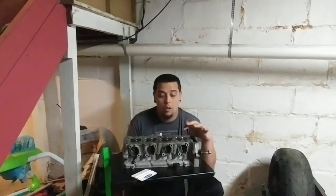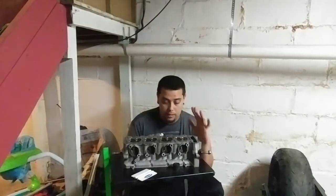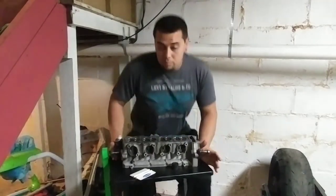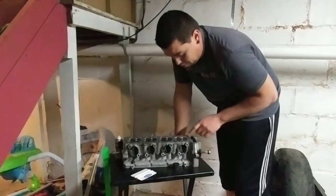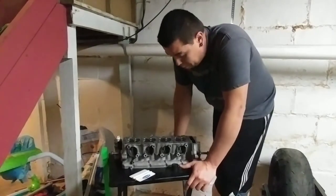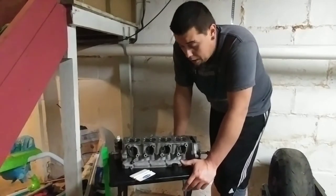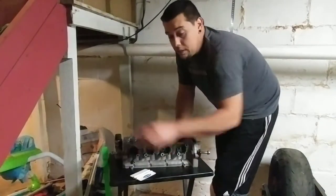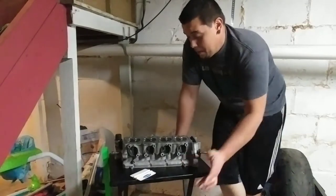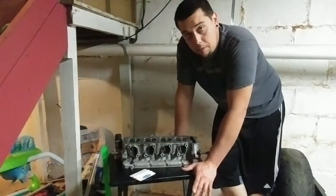I'm going to let this sit overnight, and when I get back to it, I'll let you guys see how good the stuff comes off. Cylinder four — I let it sit for 30 minutes and was able to wipe off a lot. That's why I'm going to let it sit for almost 24 hours and see how much it really pulls off. I checked the piston tops earlier — I sprayed those down, and the carbon was coming right off. You can basically wipe it with your finger and see it pulling off. When I do the piston tops, I'm going to use Scotch-Brite, but that will be a whole different video.